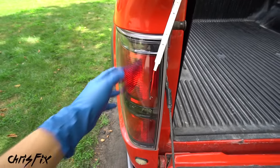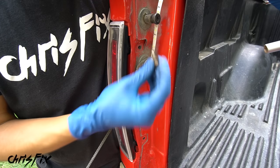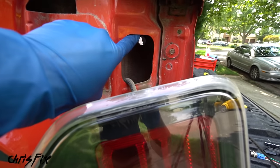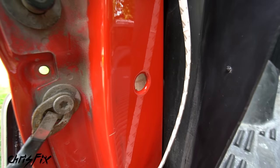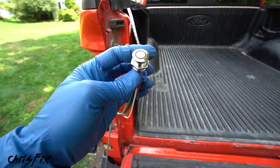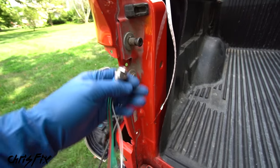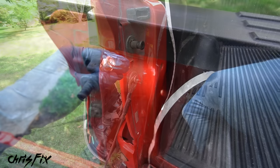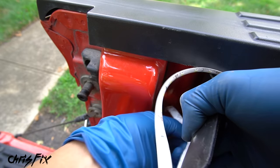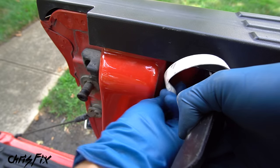Now we're going to set up the switch and magnetic switch — everything will go behind the tail light. To take it off, there should be two screws; there's only one holding it in, so unscrew that and get the tail light out. The access behind the tail light is very convenient to run all our wires. There's a factory hole right there, which means I can put our switch right in that hole and keep it factory — no extra drilling needed. There's also another hole right back here that our wires can go through for the LED lights.